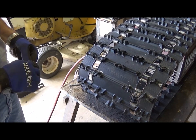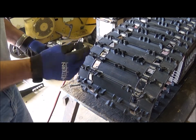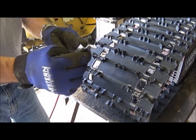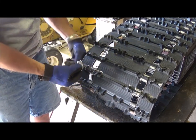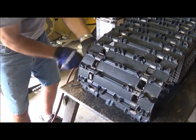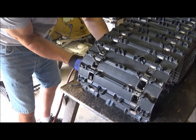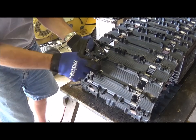We're going to show you how to put one of these guide clips on your track. You've got to orient it so that this little tab is on the outside of the track, because that's what your hyfax will run on in your suspension. What you do is set this thing up in position. I modified this tool — you can see I cut some of the edges off so that it would fit into these holes. Then you run this up on the inside. Again, make sure that little tab is facing outward.